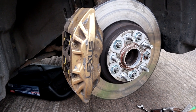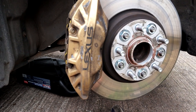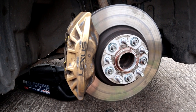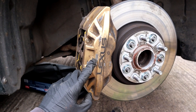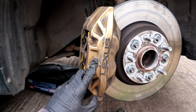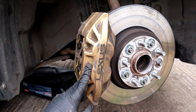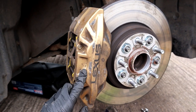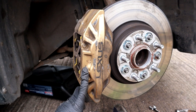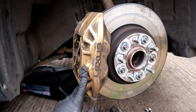And my shitty brakes. Oh, look at the state of that. This is what it was like when I installed it 9 months ago. This is what it's like now. Oh no. I think because when I sprayed this at night, after I let the primer dry after 30 minutes, it was like 10 degrees when I put the paint on. I'm pretty sure that's why it hasn't stuck, because the primer's still on the metal. But the problem is that the paint didn't stick to the primer. So, lesson for next time, even though I painted them twice, still made the same mistake.